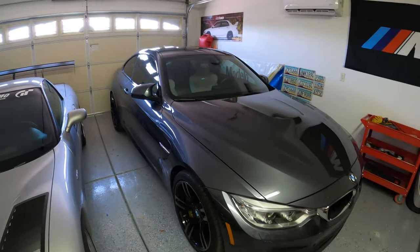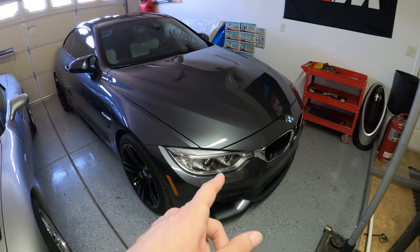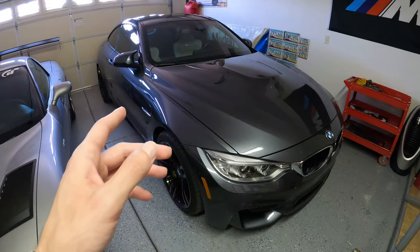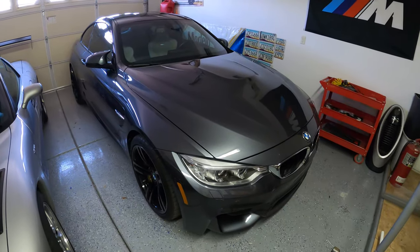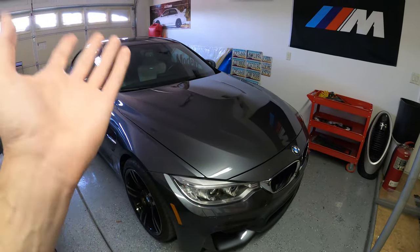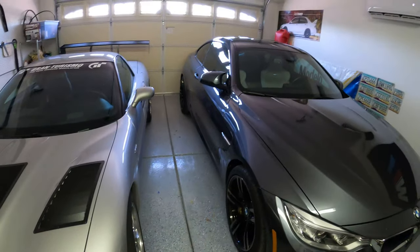And then I'm taking this car to Vader Solutions in Mesa, run by Omar, and he's gonna hook me up with getting the crank hub fixed on this. I know this is a major issue. Sometimes the crank hubs can spin because they're not one piece, and the timing gets messed up and the engine explodes. So definitely don't want that happening.